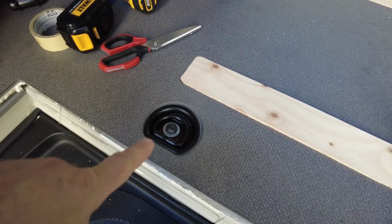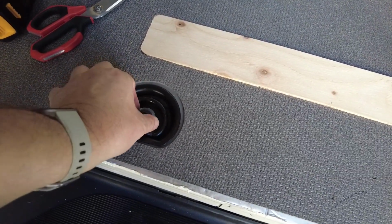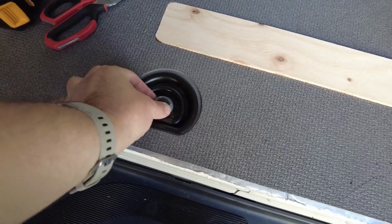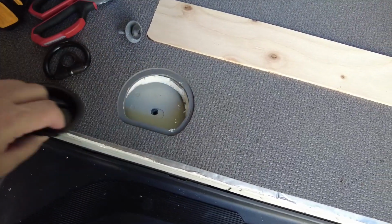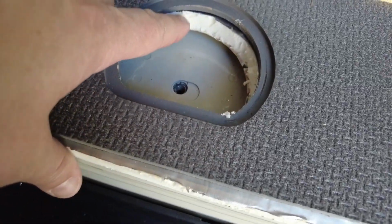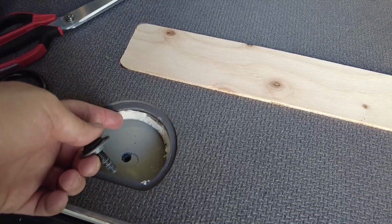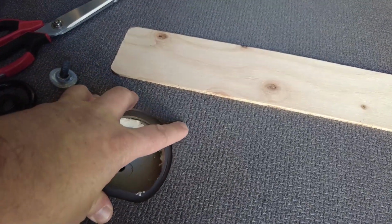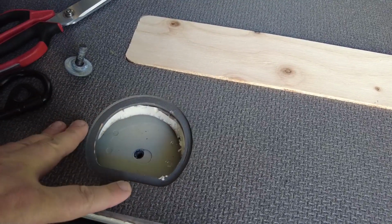And then I had second thoughts about these tie downs. Let me show you these tie downs. Okay, so let's talk about these tie downs for a second. So this one's not attached. You notice that the screw is just barely long enough. I could screw that in, but it's just not quite there. The reason for that is because I've added this extra layer of insulation there. The stock screws do fit through that extra 1/2 inch. It pulls this down just a little bit, but it's not bad. I think that works just fine.